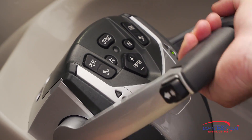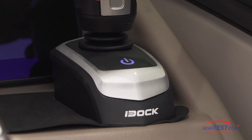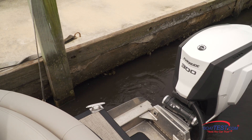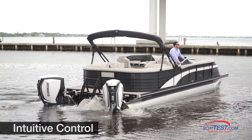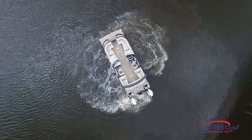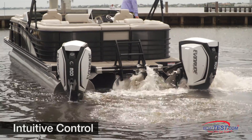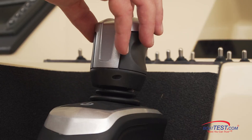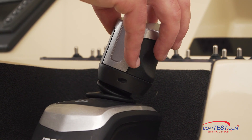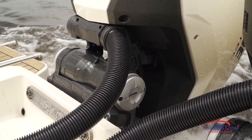To activate the joystick, simply put the controls in neutral and push the on-off button. A light verifies that it's turned on. Once activated, there are no other buttons to push or lights to look for, so the operator's eyes are not distracted from the approaching dock. By tilting the joystick in any desired direction, the boat will go that way. By twisting it, the boat will spin in place. The Evinrude joystick is progressive, which means that the farther you push it, the more power is applied and the boat responds more. To increase the thrust boost to the second, higher power stage, simply push the joystick farther into the boost position. When doing this, you'll feel the resistance, and that signals that you're entering the higher power range.